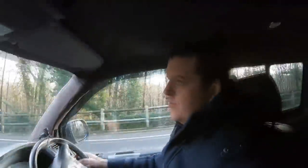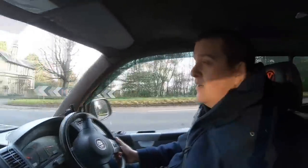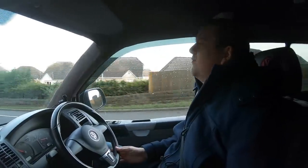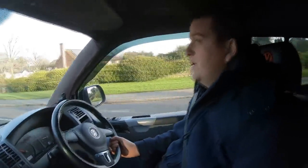In this video you saw me put oven cleaner in my turbo, which is a very odd thing to do, but for the most part that will fix most people's issues with turbos that have sticky variable nozzles or vanes. Unfortunately that has not fixed my van - that was not my problem. The oven cleaner did not fix my fault because I have an under-boost fault, not an over-boost fault. Over-boost is where your turbo gets stuck; under-boost most likely points to a boost leak or a vacuum leak. Check out the other videos to see how we progress with fixing the fault on my van. Thanks for watching.